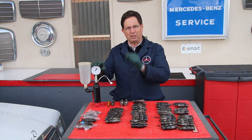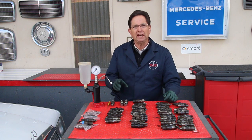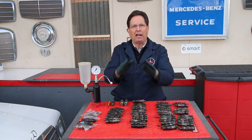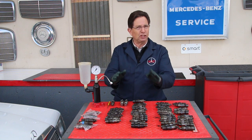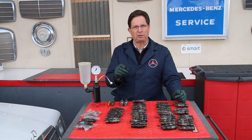This is a hand pump pressure tester and it will measure when the injector fires, as well as allow you to visually see the pattern of the spray. They should spray — they shouldn't squirt and they shouldn't leak — and they need to release at the proper time.